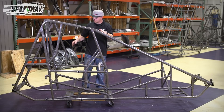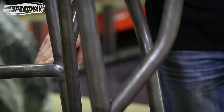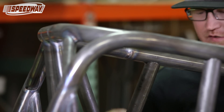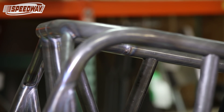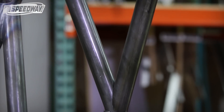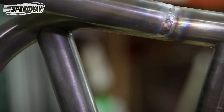With that, there's a brace that has to go in here. The rules state it has to be braced from above the shock tower crossbar in that 15 to 20 inch range — a brace from here that goes up to the top rail between that 15 and 20 inch range. It's a real easy add-on; a lot of guys don't run safety cages already. If you do, you just have to cut it out and weld the pieces back in.